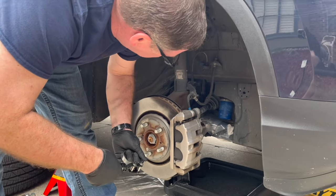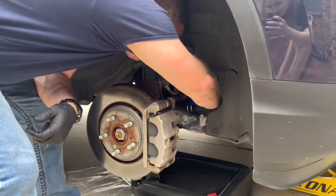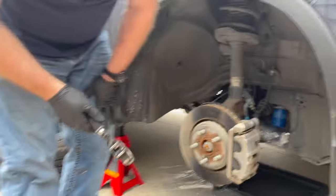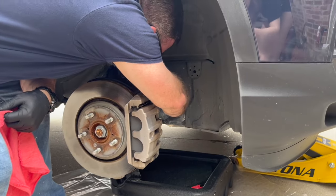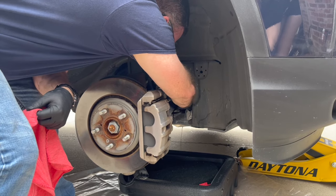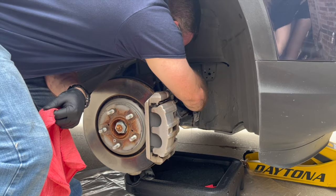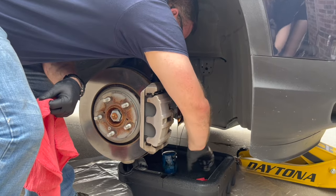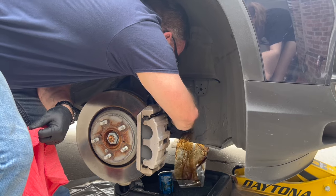You always have to think about which way you're trying to go with the strap wrench. I'm going to go this way to loosen. I'm loosening — I'll go ahead and get my wrench out before it gets oil all over it. Get a rag ready and loosen it up until it starts to drip. Okay, it's dripping. These things drip quite a bit — they have a lot of threads on them, so it takes a little while.